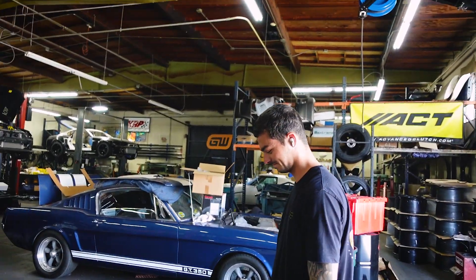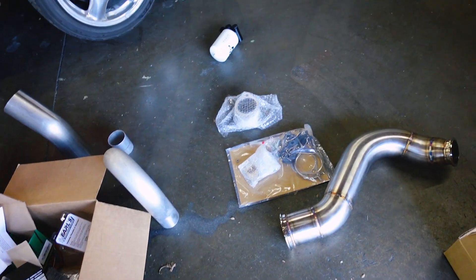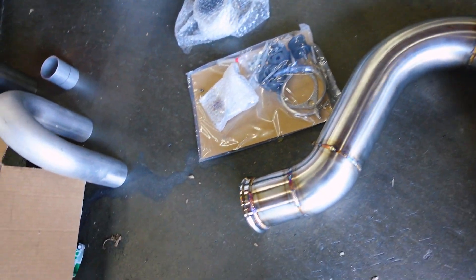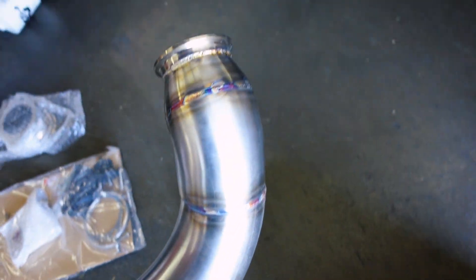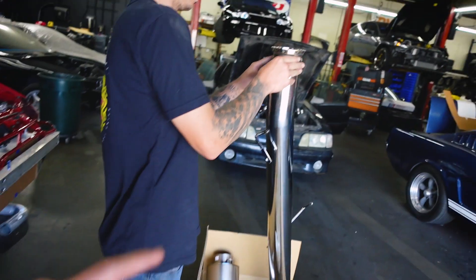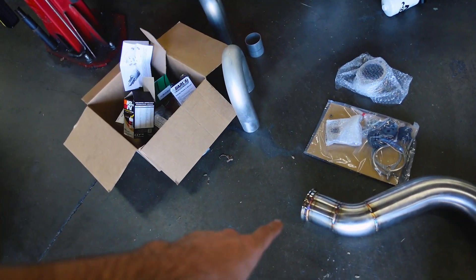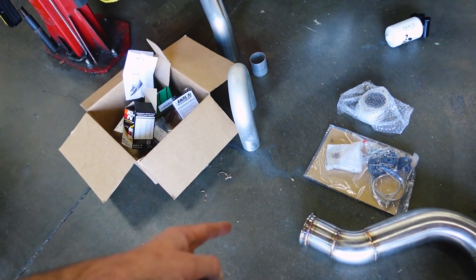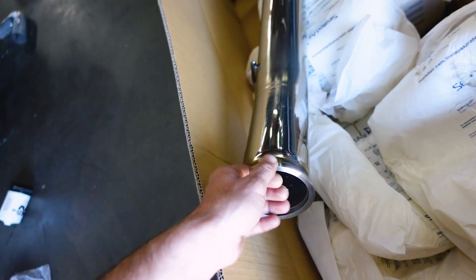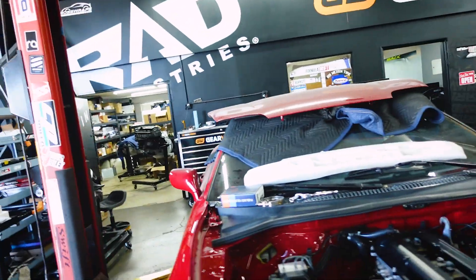Mark's going to tell you something about welding - at least show what he made. Check out that back purge - beautiful downpipe. We've still got to weld an O2 bung on there. Stainless gets heavy. What we're going to do is cut that V-band off because it doesn't mate well with the current one - we're going to use the other end of this billet V-band. There will be a billet V-band here and another billet V-band there. This is an older Japanese version and we're going to make it slightly better. We like to improve on things and make stuff work properly.